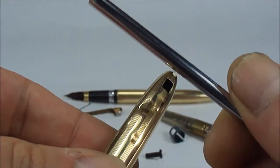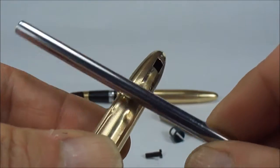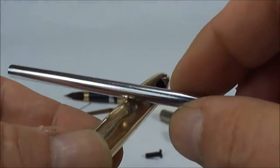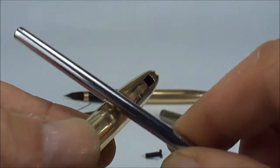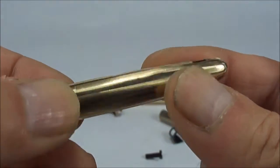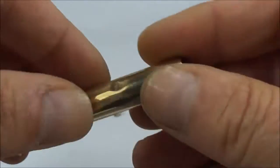When we've got the majority of the dents out as best as we can, we'll be rolling these bars up and down. Not only will I be rolling it, but I'll be using this seesaw motion as well — so as you roll, you use this seesaw motion — and hopefully what'll happen is we'll get most of these dents out and get the cap back to, as near as we can, to the original shape of it.